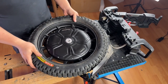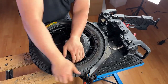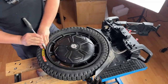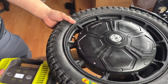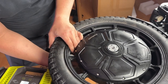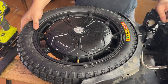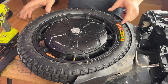Now that the tube is fully in, you can start to massage your tire and work your way around, massaging it down onto the rim. Once the tire is on and the tube is pumped up, you'll want to check the line on the tire to make sure that the bead is properly set onto the rim. If the line is not fully even across the whole thing, the tire may not be sitting on the bead properly — at that point you may need to pump up a couple PSI to hopefully expand the tire for it to jump onto the bead.